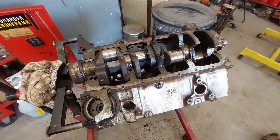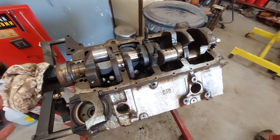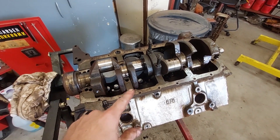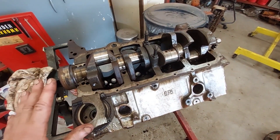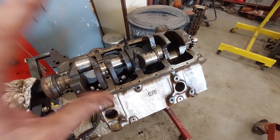Yeah, there was plenty of water, but he never cleaned anything. And that's actually a good thing if you're dealing with old motors that have been laying around. If the parts weren't cleaned, they tend to hold up better. So if you're buying engines and going to let them sit for a while, don't clean it until you're ready to build it. Just a little tip — the oil that's on it will help preserve it.